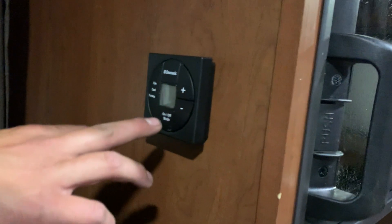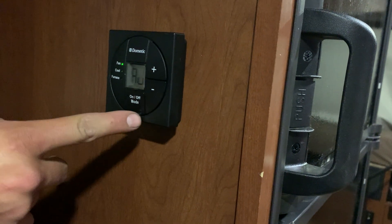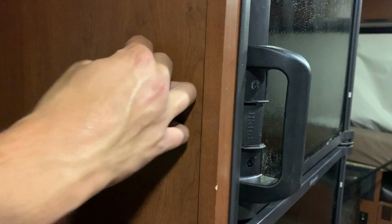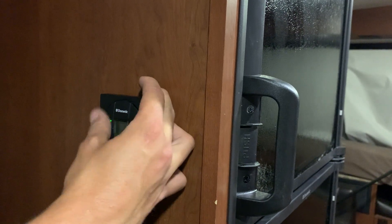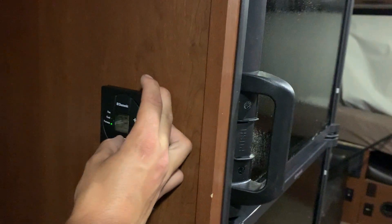Right beside the third bed you do have your thermostat. Hit that button and you come into fan mode — this is just the fan running and you can go between high and low. Go into cool and this is the AC part kicking in, and these buttons change your temperature selection. To change fan speed you have to click back to fan mode. Hit that button again once you're in cool to go into furnace — your furnace is going to kick on. The furnace runs on propane. Propane is heavier than air so it's going to sit on the ground, and the LP detector right here is going to detect that. If that ever goes off, make sure you turn off the propane to the unit and open up any windows to let it air out.